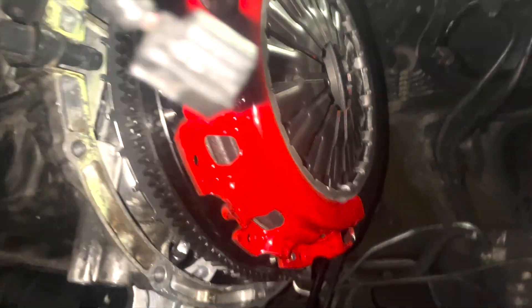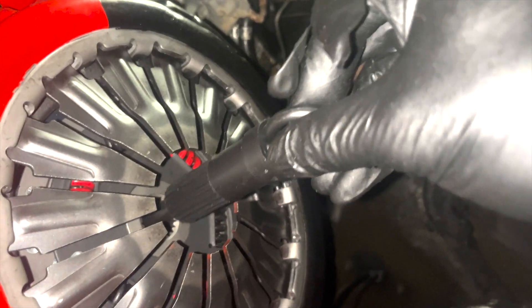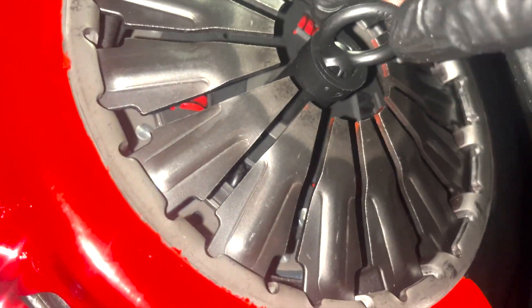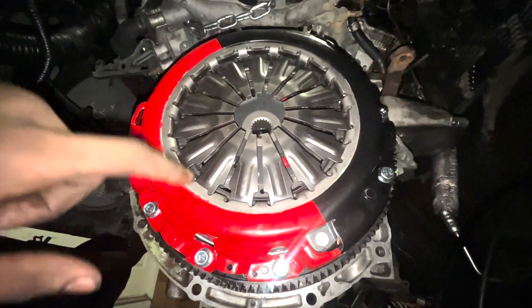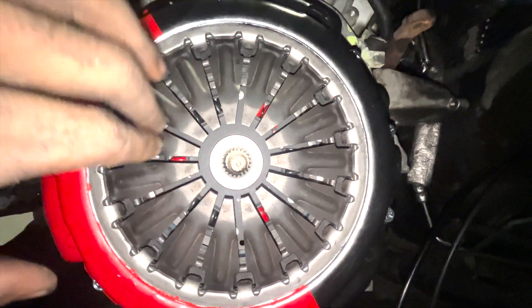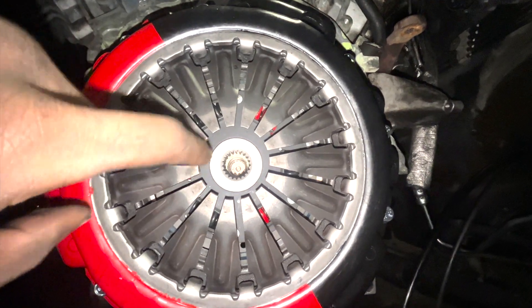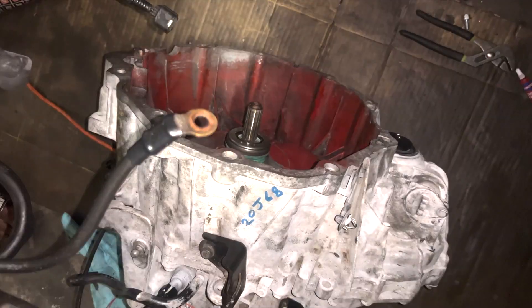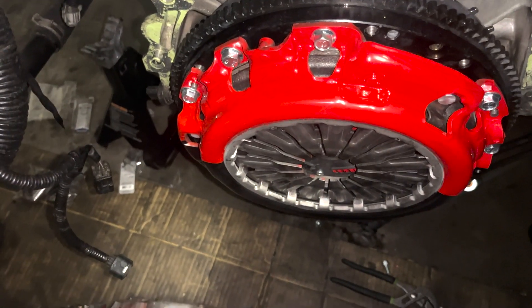Right now I have a mock-up pressure plate and clutch. The alignment tool doesn't give you a precise fit here because there are no splines inside for it to grab, so you have to eyeball it. I'm looking in the little grooves to make sure the plate is aligned all around, and so far everything is sitting pretty much aligned on all corners. I installed the pressure plate — I put the clutch alignment tool in, held it in the middle, put the pressure plate on, and it was centered as best as possible. I went ahead and torqued all the bolts to about 34 foot-pounds of torque.